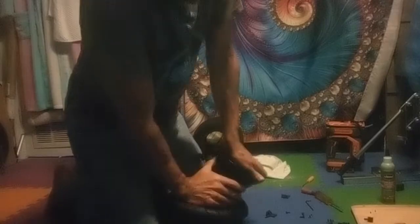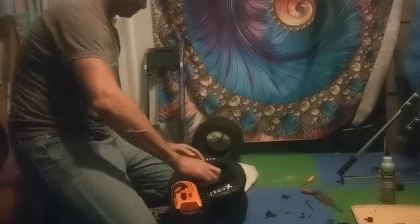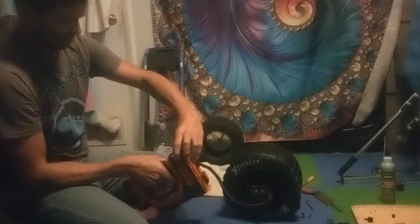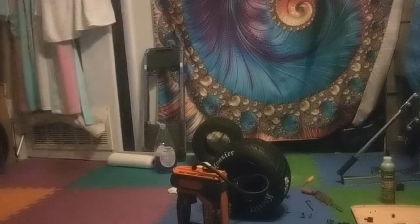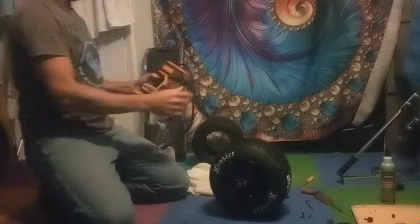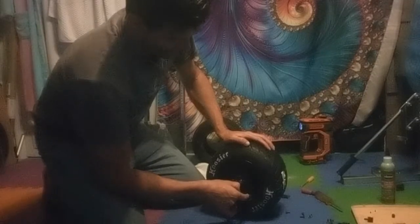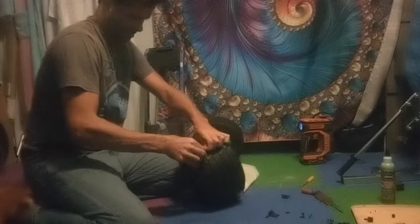Here I am pushing the tire in. That's a little tough sometimes, but that went on pretty quickly. Once you've got the tire inside the rim, you're okay. I'm about to fill it with air to seat it. I set the air compressor to about 60 to 80 pounds. I'm actually outside the room in case the thing blows up — I've never blown up a tire before. You have to get almost up to about 60 or 80 PSI. It says don't go over 40 or 50 PSI, but I spent hours trying not to exceed that and it didn't seat. I haven't busted a tire yet.